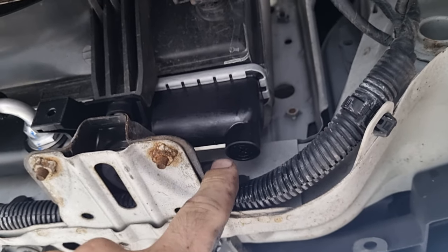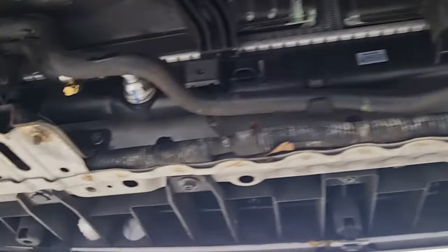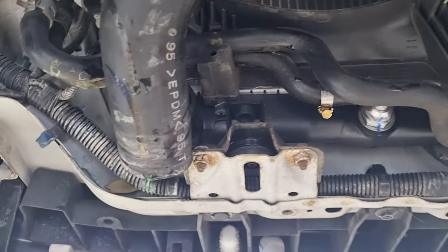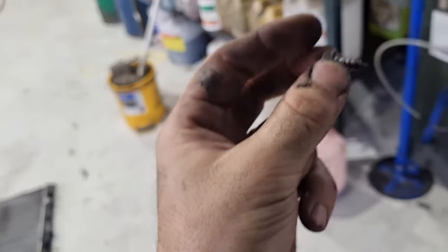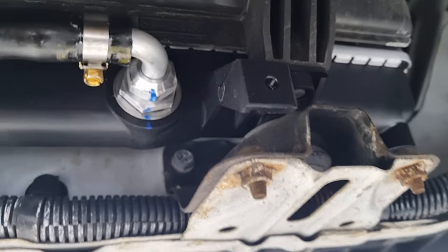Check the tap on the radiator, make sure it's tight, plug your fan in, put your trans cooler line on, and put your clamp on — I just like to face them down, it looks pretty nice and it's pretty easy to get to. Make sure the clamp is facing the same way, do a professional job, clip it in — they both clip in there. Plug your fan in, then put your lower hose on. We use new clamps — you can reuse the spring clamps if you want, but sometimes we've had them leak, so we always replace them, just cheap insurance. Now grab the heat shield and put it back up — these are actually screws that take a little bit of winding in the first time, and it's a blind hole so it has to screw in there, it might take a little bit of effort.